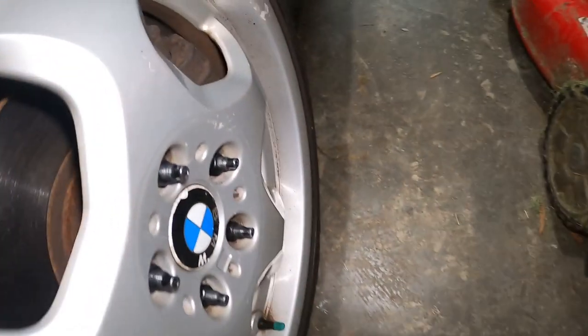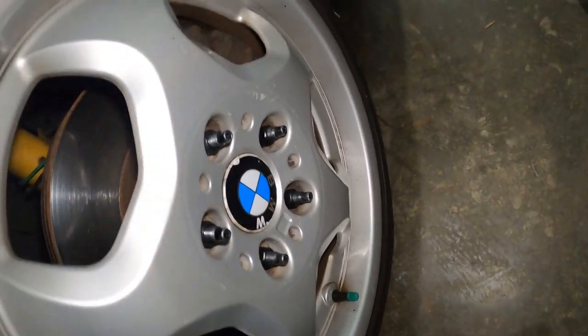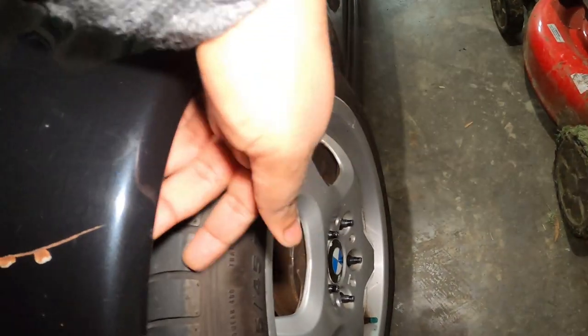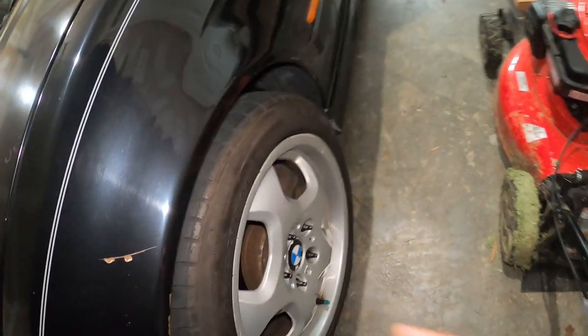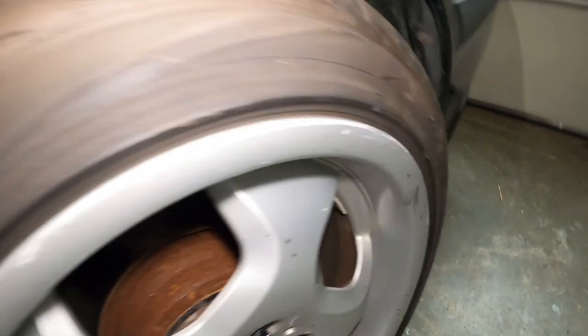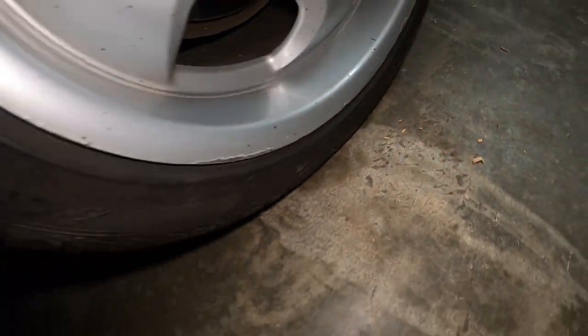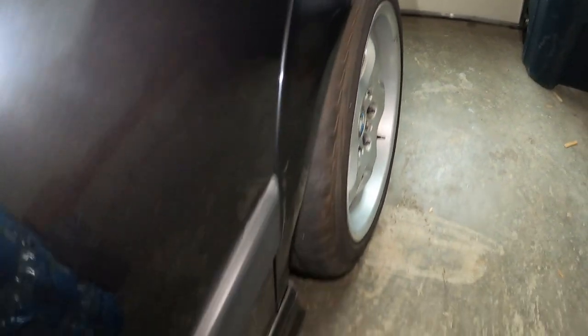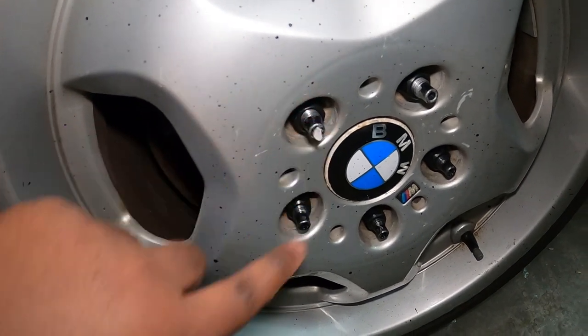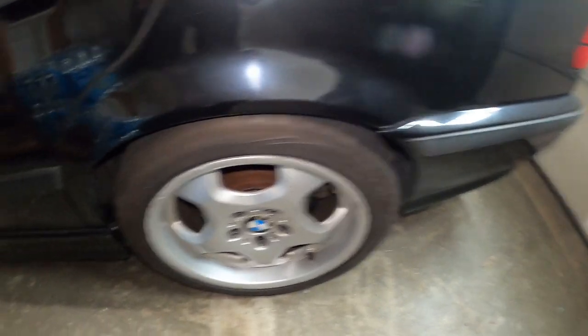As you can see this is the finished product — it's looking really nice. I still have to torque it to 109. You can see the 5mm makes the wheel poke just a tiny bit but it's still way under the fender, and once I lower the car it's going to be perfect. I'm running 225/45/17 up front. The back is nice — the 10mm provides a flush look. I'm running 245/40/17 in the back, so I could definitely fit a 255 tire there. Looking really nice, I love it. It doesn't drastically change the look but the tire looks really fat.